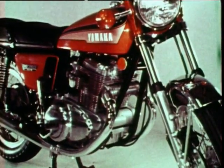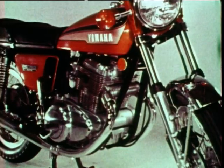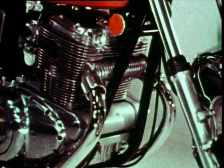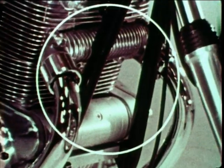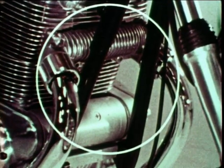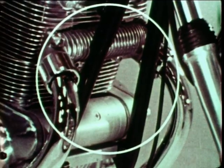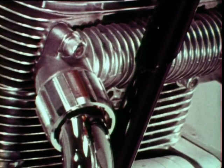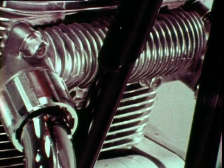Besides the valve seat, the new design features include a new joint exhaust pipe. This is for noise reduction. This is where improvement is made. The two exhaust pipes are joined at the outlet. The noise level can be reduced through labyrinth construction. To lower the noise, the number of partitions should be increased.